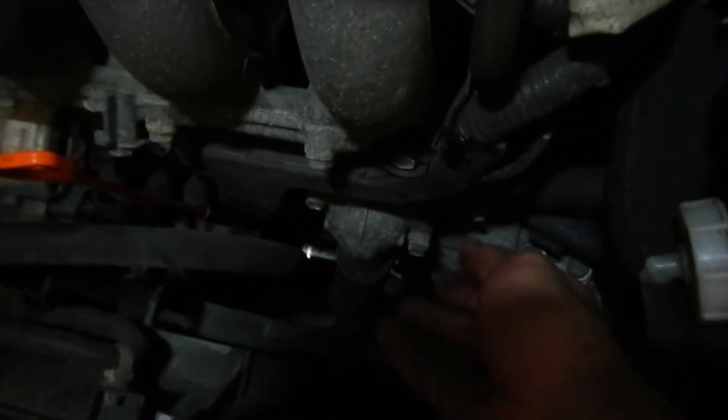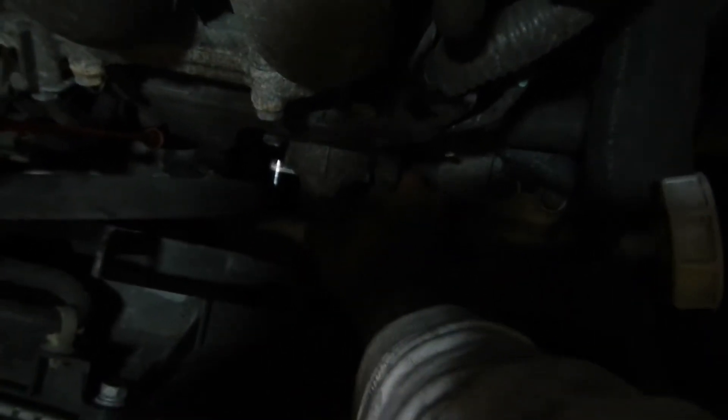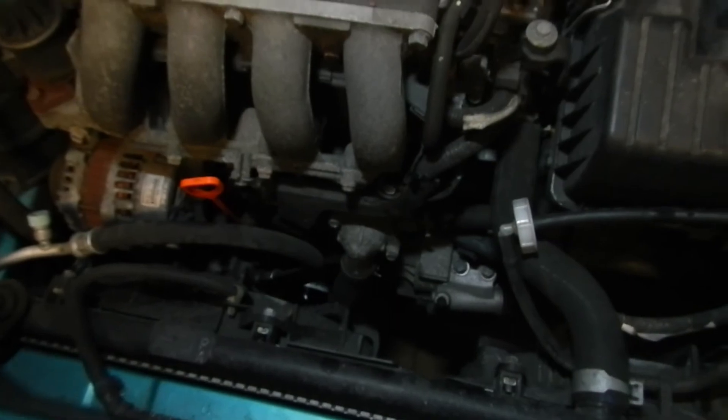What we're doing now is running the engine to get the air out of the system. Very carefully, reach down here — I don't have the expansion tube in so I can reach easier. Don't touch the fan because if it turns on it'll shred you pretty hard. Squeeze this hose to burp some of the air out. Once it gets hot, turn the heat on also to get everything circulating around.